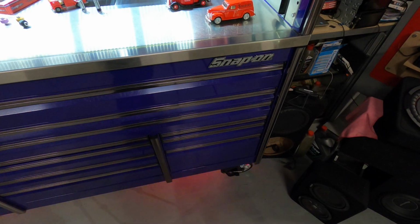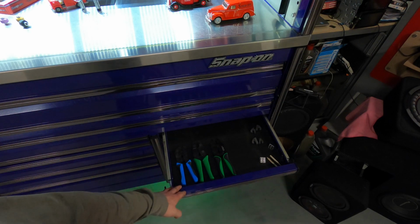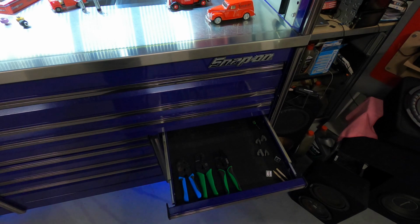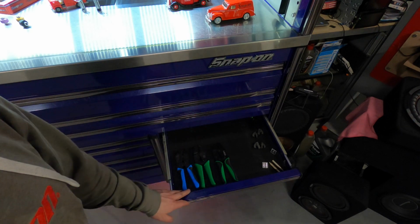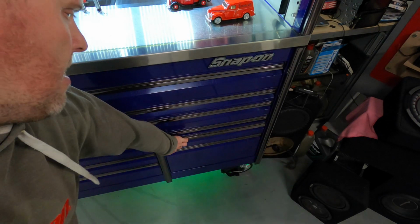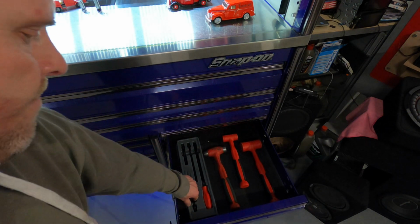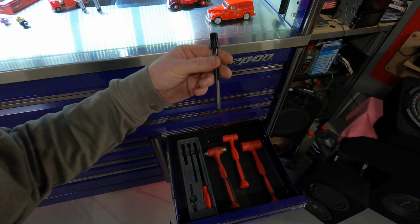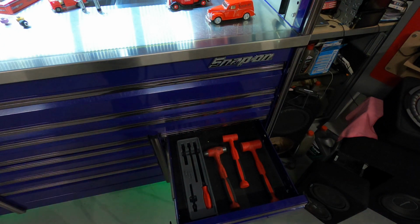And now we're kind of moving over to the right hand side of the toolbox. I've got various crimp tools and adjustment crimp tools. These are for like the terminals, which we do, the waterproof connections, the Delphi connections, all kind of type of digital aerial connections, crimping tools, the FME and things like that. My through and through tool, as we call it, the pokey tool. You thread this through a grommet and then you can push a cable through there and it allows you to pull a cable through the firewall, nice and simple.